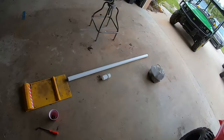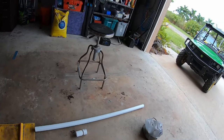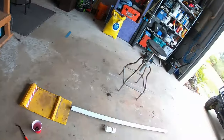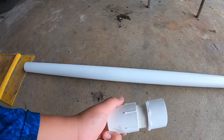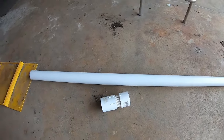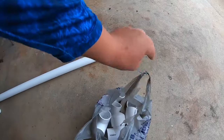I have a 10-foot piece of 1.5-inch piping, which is what I need as the pipe that comes out of the airbox and everywhere else. I have a cup and a little rivet removing tool so I can remove all the rivets to get to the plastics. This piece here, I forget the names of the two parts, so this is going to come up through the plastic or wherever I need it to in order to attach the snorkel to the rest of the piping. And in here, we got a whole bunch of different couplings and glue and pieces to attach the snorkel in various ways,